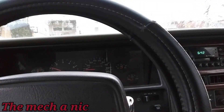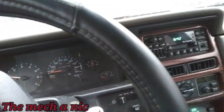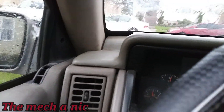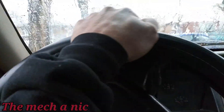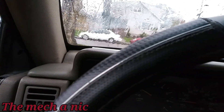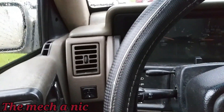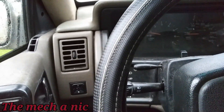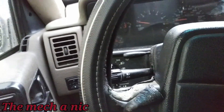It's a few days later and I'm finally getting the Jeep into the garage. What took so long is the owner told me that without the driveshaft the Jeep won't go forward — it would only go in reverse. I was going to have to get someone to help me push it forward so I could back it into the garage. But the car is supposed to be all-wheel drive, so I put it in drive and it actually moved forward. Now backing it in, the transmission just takes forever to grab — you put it in reverse and let it sit for like 15 seconds before it decides to grab.